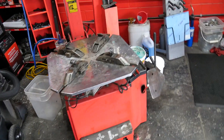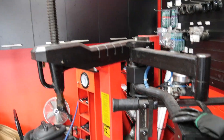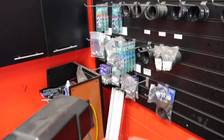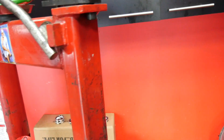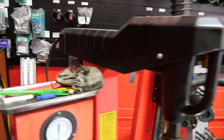Now, tilt back. One positive fact about tilt back is you can do very, very big tires — 37 inch, 40 inch tires. But a negative factor of the tilt back is that it requires so much room in the back. You can slide this all the way back or forward, and you need that much room to compensate. They're also very slow, opposed to the swing arm which you can move right over. I'll tilt this back so you can see right now how much room is required.